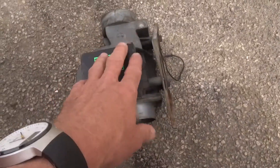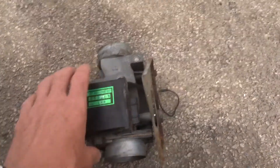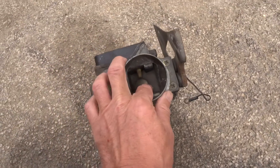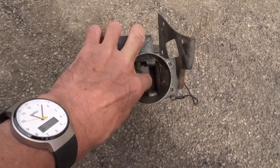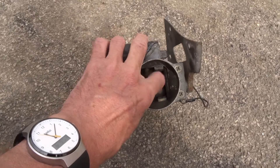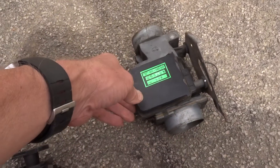If we look over here, this is your MAF sensor — mass air flow — and as you can see inside there's a flap that the air has to push against to open up, and that resistance is slowing your air down because it has to push against it. So you're getting better air flow and no restrictions — it's just a tube now.